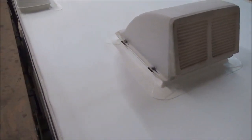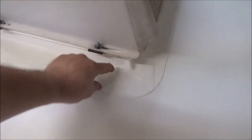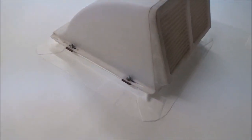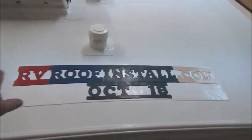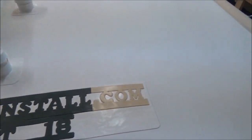This is all commercial application. This is a 60 mil GAF TPO. It's a thermoplastic. Everything heat welds together. So all the curbs, the one up there in the AC and this one here, that's a 3-inch flange. We heat weld all of that. We don't just do this edge. We do the whole thing. So that's a heck of a water drop if it thinks it's going to get its way all the way through there. Heat welding is just like welding 2 pieces of metal together. Same thing here. We've got all that heat welded. And then we put our brand on here so people know who installed the roof. There's the month and the year that we put it down, so we can monitor the roof and make sure it's performing and doing exactly what it's supposed to do for what we got paid to do.